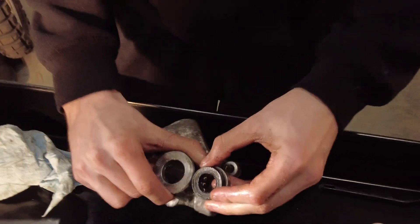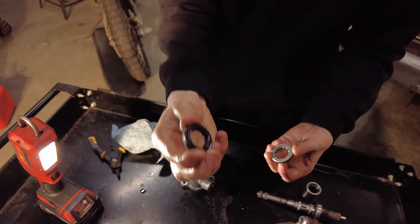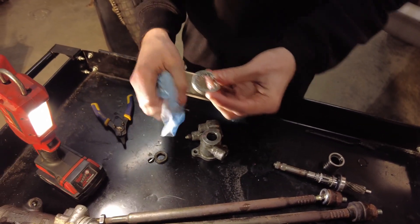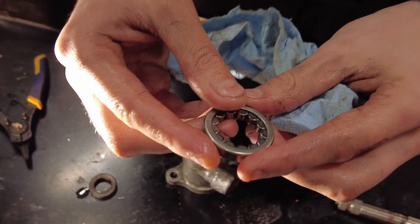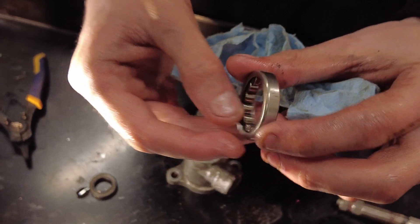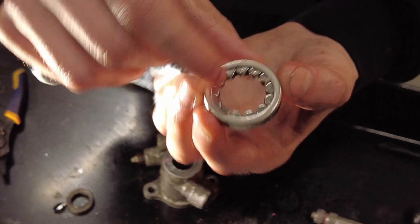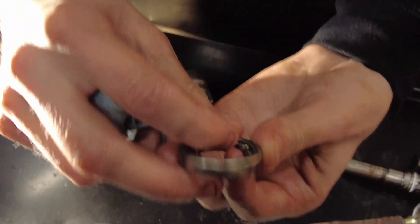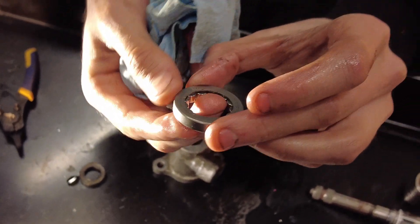These parts were buried down in the end here. A spring-back U-cup shaft seal was on top of this cylindrical bearing, which is actually pretty interesting. The housing on this thing is weird — it's like super cheap feeling drawn cup style, and it's very thin compared to the size. It also has no cage — there's just cylindrical rollers in there, stacked edge to edge, no space. I think they call these full complement bearings.